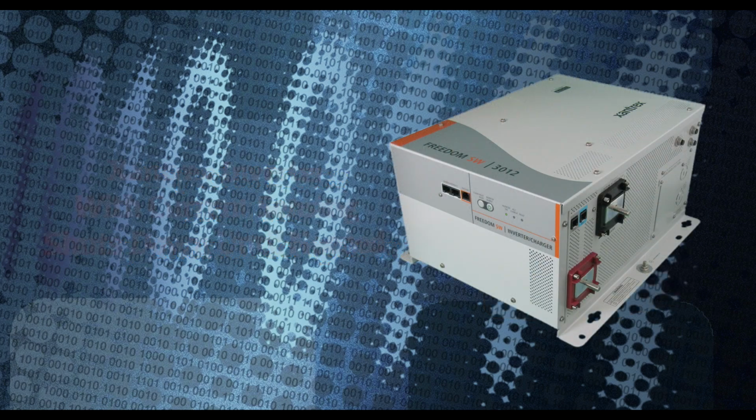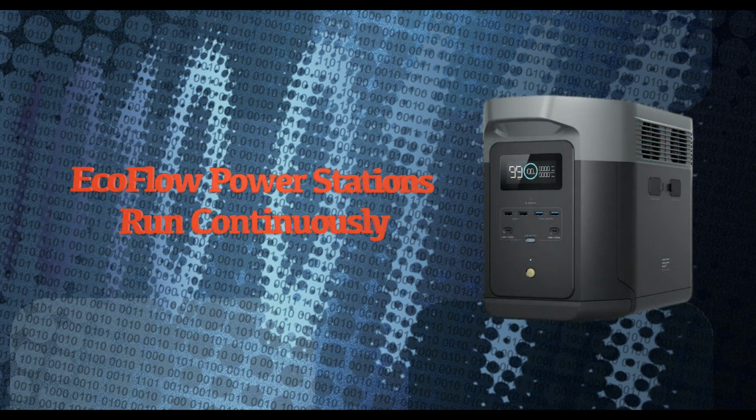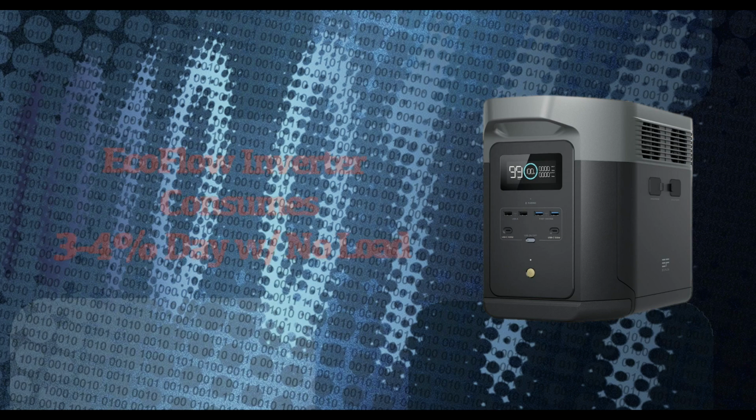Unlike a Xantrex inverter, which employs current sensing, which shuts down the inverter when there's no load, EcoFlow stations run continuously. Therefore, disabling AC power when not in use adds capacity. The inverter can consume 3 to 4% a day sitting idle with no loads.